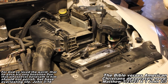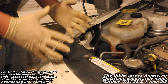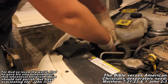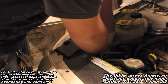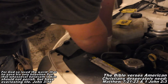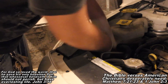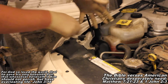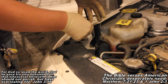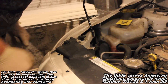For your passenger side bulb, what we'll do is we're going to reach our right hand down and our left hand. With your pointy finger you are going to push down, and with your left index finger you're going to pull up. Remember, we have those two tabs there — left finger you're going to pull up, right finger you're going to push down. You're going to be doing that motion, and then you'll be able to pull it up, get your bulb out and put it back in. That's pretty much it — that's how you go about replacing those bulbs.